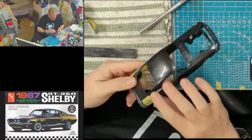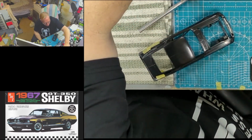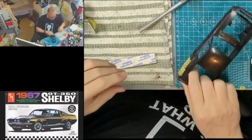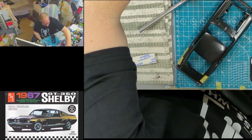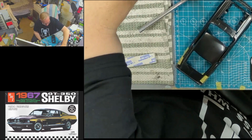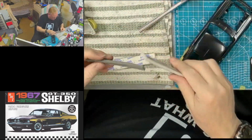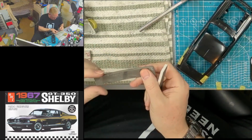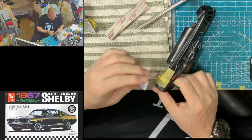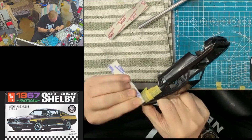Okay, now I can go to some less harsh sanding sponges, such as maybe a 2000 or something like that, or even a 1000 to start. I'll start with a 1000, and we're going to move up from there. I do have 2000, but not much. We'll go 1000, and then I seem to be missing some of mine. I have misplaced my sanding sponge. There they are. They're hiding on me. These guys here. 4000. This is a different 1000. Two different 1000s. This one's kind of old. I'll use a new one. A new 1000. And then we'll go up to 4000. And then maybe 6. I think even just going to 4000 after the 1000 is going to be an improvement in itself.